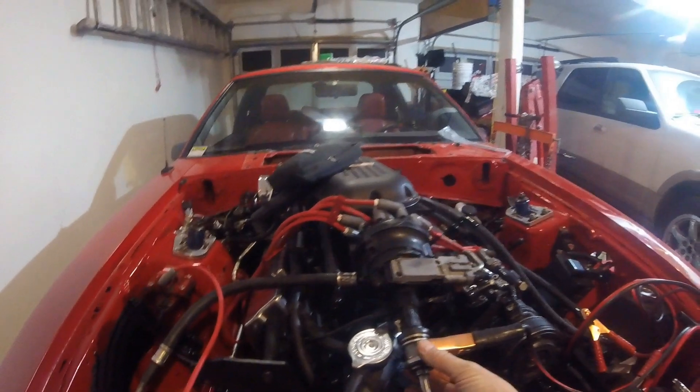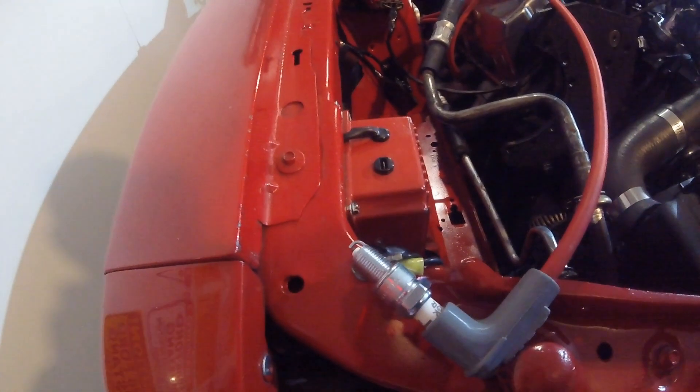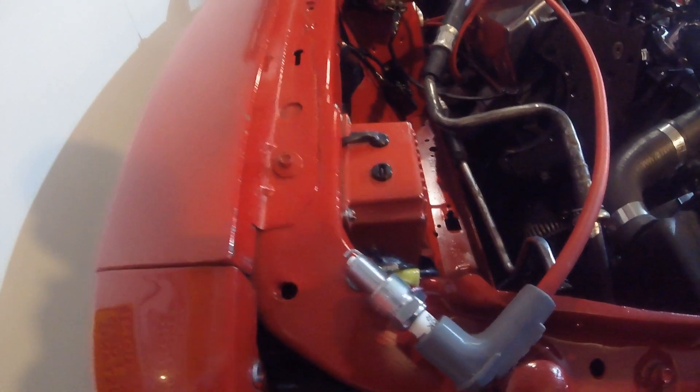Take your distributor out, make sure you ground the body of it. Also note that it will run the fuel pump if you have the relay in, so I've got my relay out so it's not running the fuel pump during this process. Whatever is spraying into the cylinders, I don't have much pressure in there — that's one way you can mitigate the amount of fuel sprayed in. What we are checking here is our spark, and this verifies that our TFI module is good and also that our pickup is good.